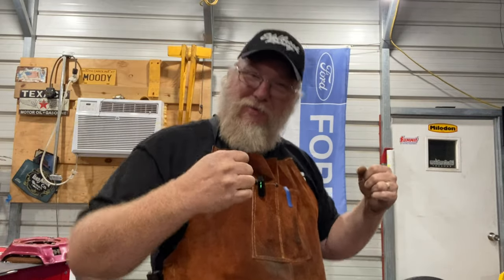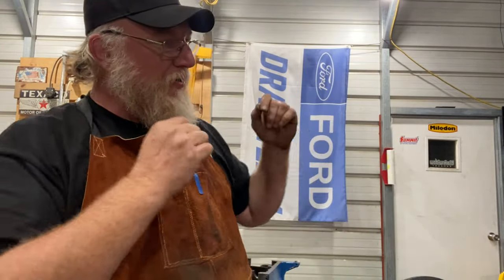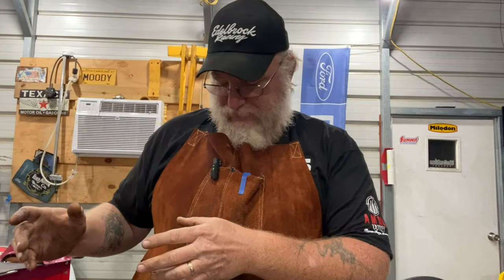It helps on the shift if you tune that in just right, and that goes back to the transmission - it has to work together. With that transmission at 7,000 RPM I can drop right to the next gear. I'm holding at 7,000, I've got that clutch nailed in, and when I click that back it's still clamped and I get it all from that shift. But if you have to let off the gas, push the clutch in, go to the next gear, let off the clutch, push in the gas - you've lost so many RPMs. By the time you hammer it back, you're back to your base setting and you're going to slip a little when you go to the next gear.